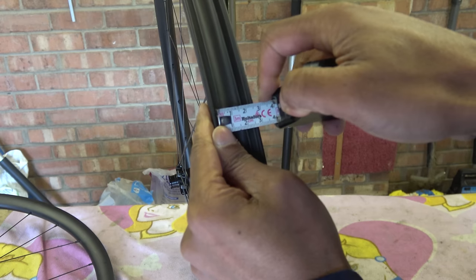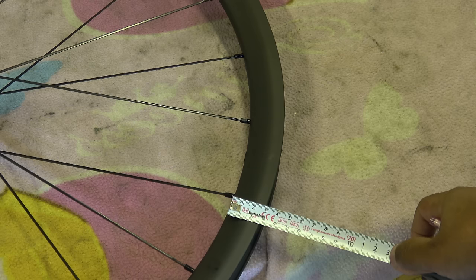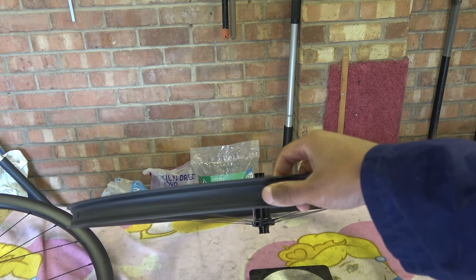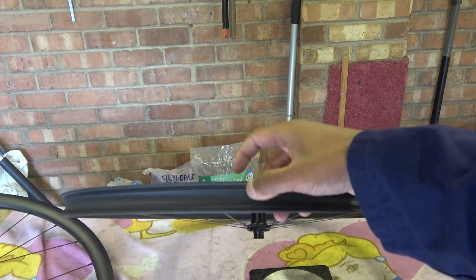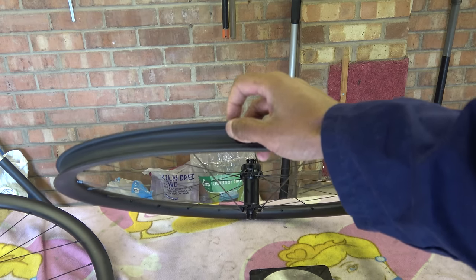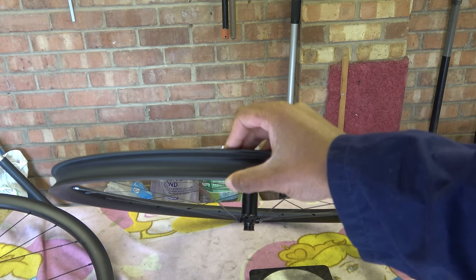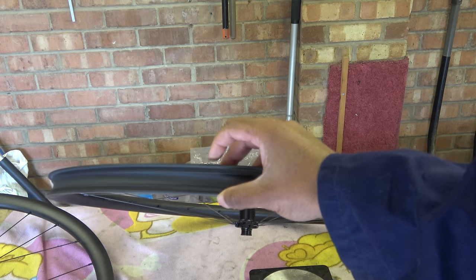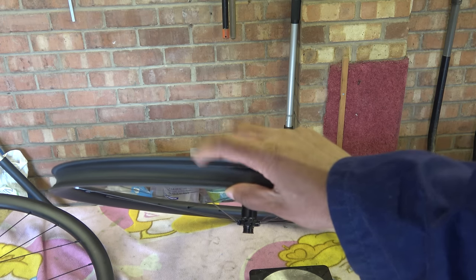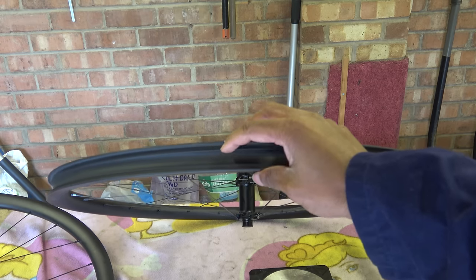The inside of this wheel is around about 24mm and the outside is about 30mm. Looking at the rim bed, there are no spoke holes in here — that is a trend that's coming because you don't need to put any rim tape on there. So if you're running tubeless, you can just do that straight away. This is not a hookless rim — it's got a hook — so the chance of losing the tyre in a sudden moment is fairly limited. You can get these in hookless as well, but for safety I'd probably get the hooked version. I've only run these with TPU inner tubes from Ride Now, and I've not really had any problems at all — it's just a fit-and-forget system.